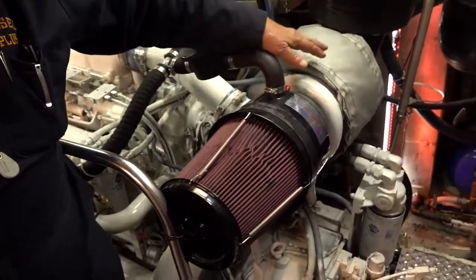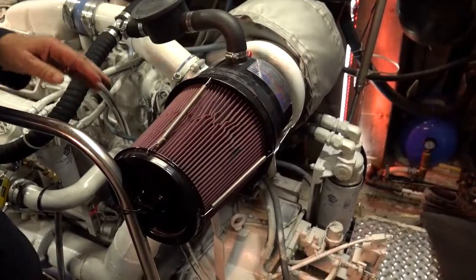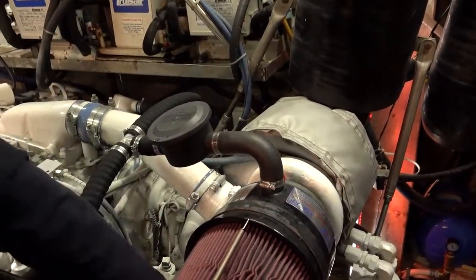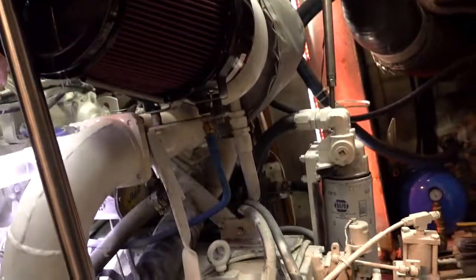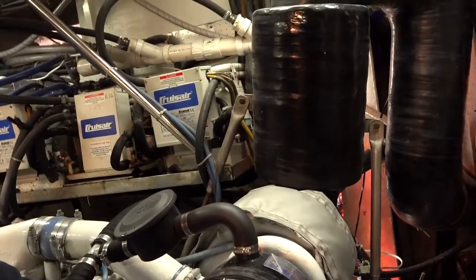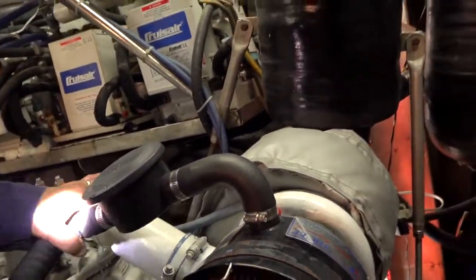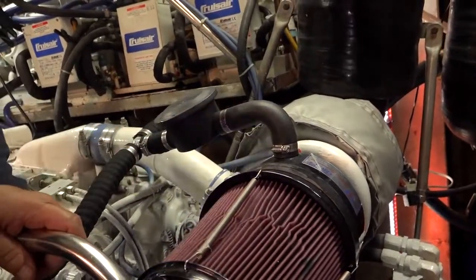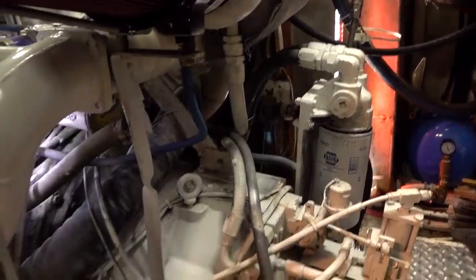This is the turbo. This is the air intake, which is an air separator. The air separator pulls vapors through these two hoses and then drains the vapor back into the engine. The vapors come from the valve cover — they go through here from both valve covers into the air separator, which has two housings, and then underneath it drains back into the engine.